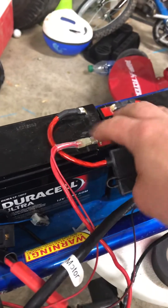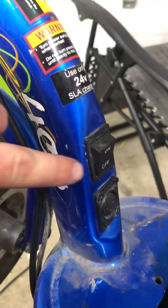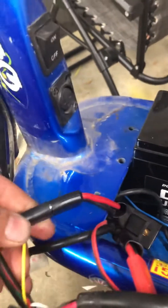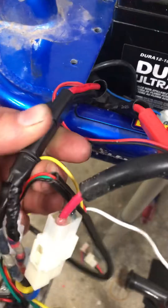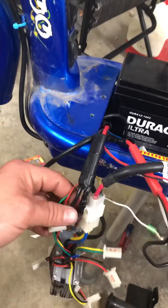The yellow goes to positive, which gives you this indicator light showing how much juice is in the battery. But if you hook it directly to the 48 volt main, it'll just always be on. Since I've rigged this from scratch, I came in here — this is basically coming from the switch to the controller — and I just tapped into the positive before the controller.